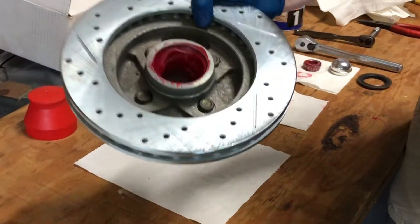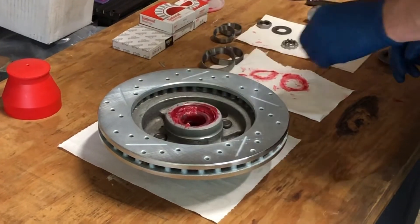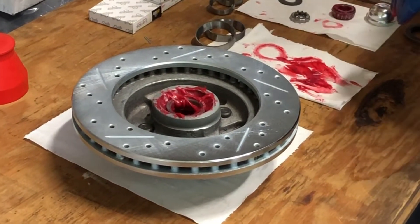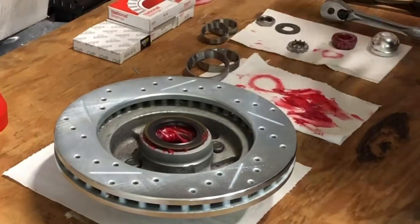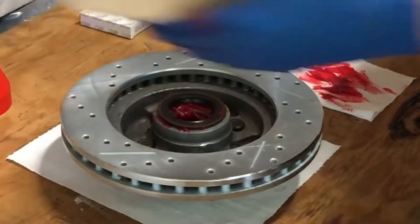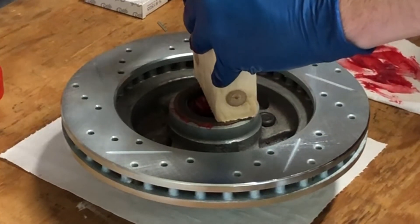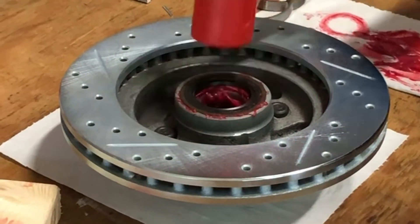So that's about what you want it to look like. I'm going to drop in a bearing, do a little bit more grease - can't have too much. Then we've got our seal. You want to drive the seal in as straight as possible. I'm going to use a 2x4 on its end. Got grease all over it so I can't pick it up easily. Just make sure this is seated all the way around - looks good. Now we're going to flip it over.